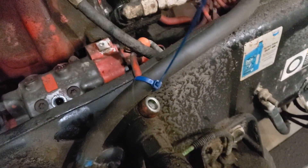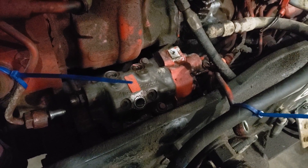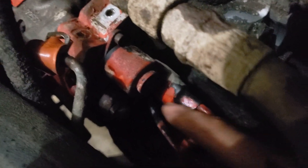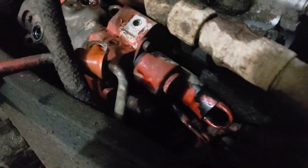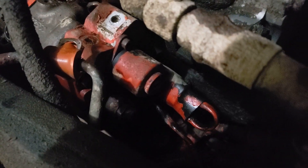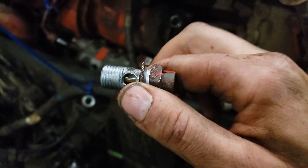I ended up just taking a couple of zip ties and tying these two lines out of the way — it just makes it easier to get the head off after, so they're not interfering in any way. There's one more low pressure return line off the back of the head on the pump here. It's located right below the regulator or fuel solenoid. Take a ratchet and a deep socket, just break it loose and then spin it out. It actually has a check valve built into it to keep fuel from draining back.